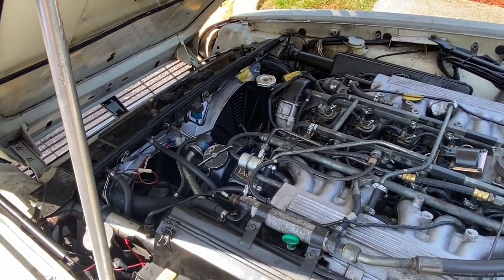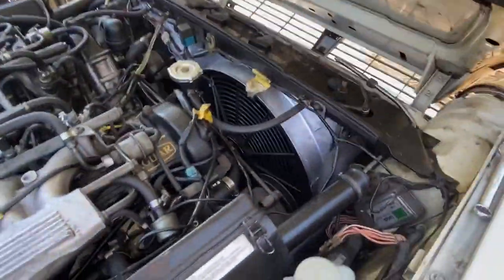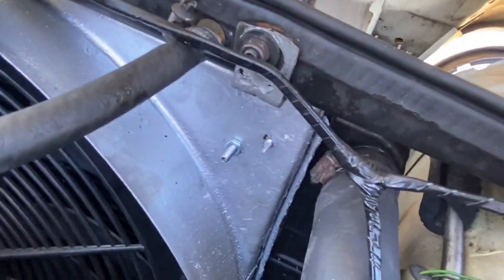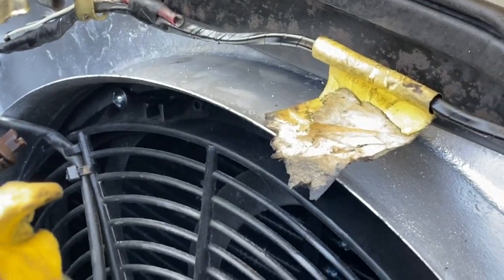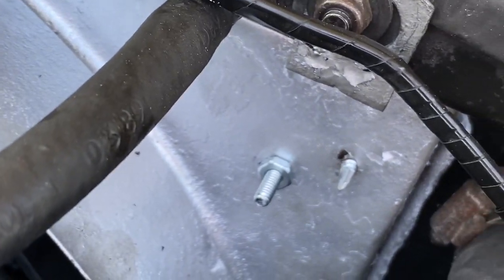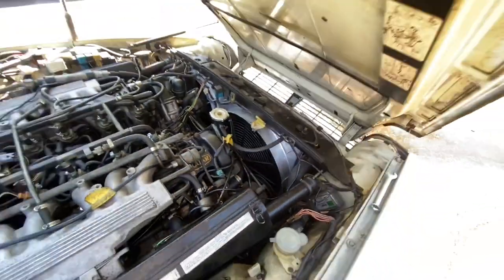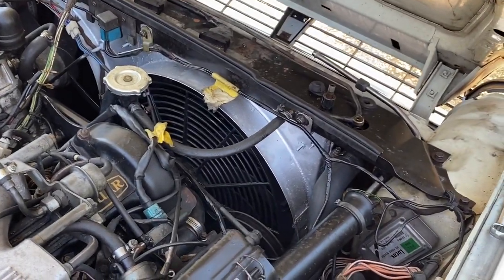The shroud required some modification — hard to see because it's behind so much stuff. I took some sheet metal with a friend, cut a hole in the middle, so the sheet metal only follows the very edge, and that's where I mounted the fan. You can see the screws in the top left. I mounted the sheet metal to the shroud with self-tapping screws and some nuts and bolts. You can get creative — modify the shroud how you want — just make sure it's tight so airflow goes through and seal all the gaps so everything is consistent.